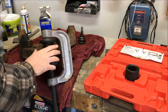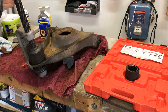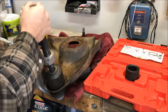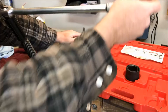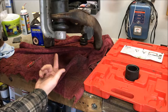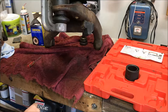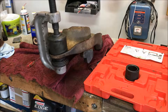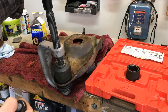As awkward as that looked, it's all tight now. Let's turn it upside down. As we crank down on this with a 7/8 inch socket and a breaker bar — you might need an even bigger breaker bar — what's happening is this is spinning down, pushing down on here, which puts upward force here, which puts force on the ball joint, which is hopefully going to press the ball joint out into the receiving cup. We'll put it on the ground so I can get a little more leverage. On a car it might be even a bit easier if the control arm is attached. But if we try to put too much torque on it right now it's just going to spin on the bench, so I'm going to put it on the ground and stand on it.